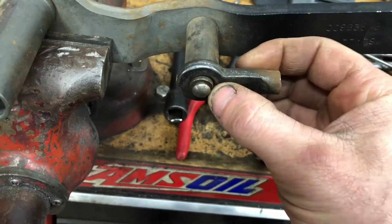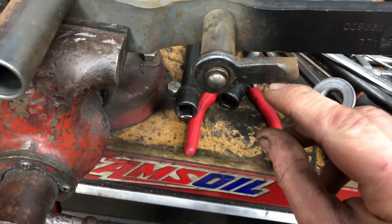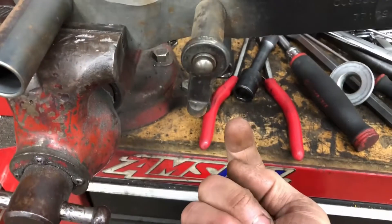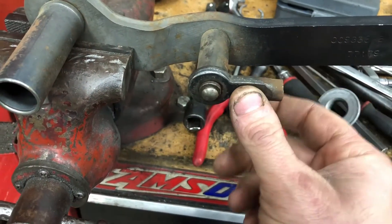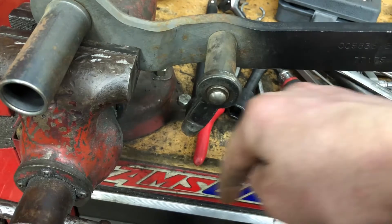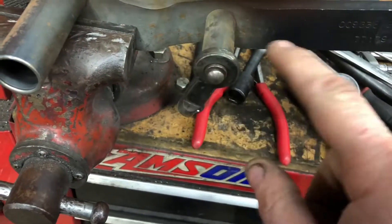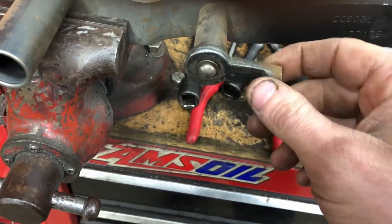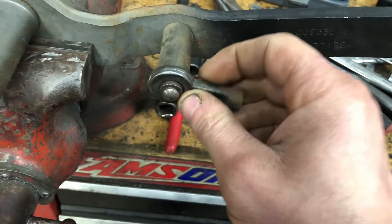What I need this for is I'm going to take this and make another piece that'll come off this way with a threaded portion, so the threaded rod that comes out of the master cylinder can thread in for adjustment, and then it'll have a jam nut setup. So I won't be moving the master cylinder rod up — I'll just be moving this pivot point up and using an angled adapter piece. I'll still get my leverage on it; I just have to make sure it's pretty beefy.